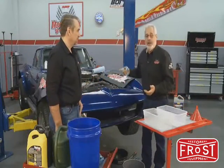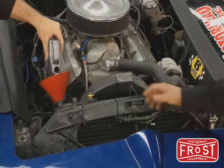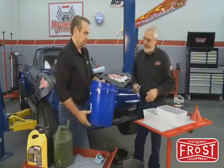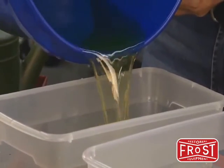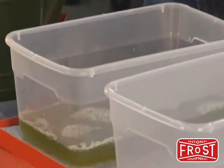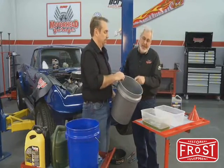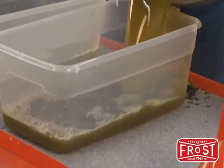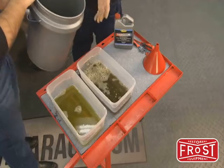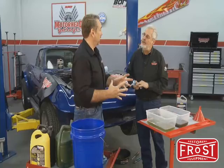Earlier in the show, we started off with a rusty cooling system and we put in the Thermocure after we drained it, put in some water, and ran it through several times. Here's what we had originally — that was green antifreeze when it started, but you can see it's got a reddish, rusty tint to it. The rust is an insulator and you can't exchange the heat. This is the drain right after our first drain after adding the Thermocure. It pulls out the rust and it dissolves — it doesn't bring out flakes or anything to plug you up. It's going to make it a liquid iron, so you'll have all that rust out of your engine.